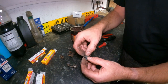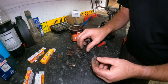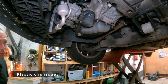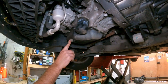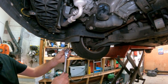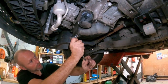You can normally get hold of it with your fingers and just pull it. Just be aware, sometimes they can be a bit fiddly - they look quite simple but they can be a bit of a pain. Now the under tray is removed you can clearly see the spin-on oil filter and the sump plug. That's a 17mm, so I'm going to use a 17mm single hex socket - you've got a lot better purchase and less chance of slipping and rounding it.